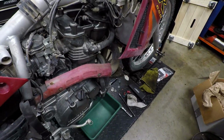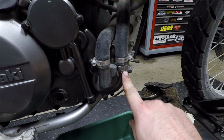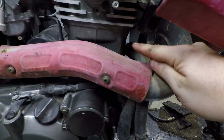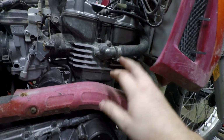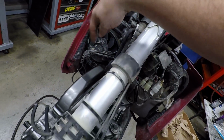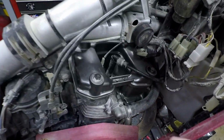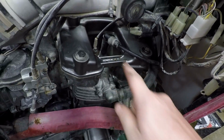Now, taking a look at the stock cooling system, you can see our water pump here, and this marking here says up to the cylinder, so this hose runs up to the front of the cylinder here, gets circulated around, picks up temperature, and then draws it out of the engine, and it exits through your thermostat housing here, runs up to your upper radiator hose, cooled through the radiator, and comes back down and exits into the water pump. So our factory setup has its sensor placed right here in the cylinder head, and that is our closest point here to get the same reading.